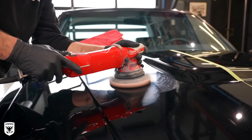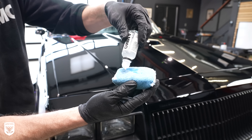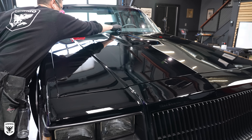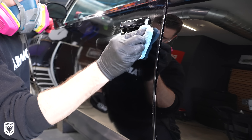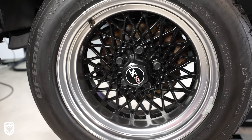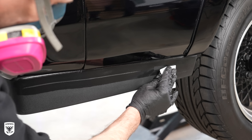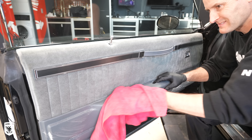Now, if we talk about the pad — I like utilizing a used pad when the paint is being really soft, sticky, or weird. I go with a used one versus one that is brand new. The analogy I like to use is it's like putting on jeans you've had for many years versus a new stiff pair from the store. This was a used pad, but I cleaned it out and dried it, going through all the proper process to make sure it's nice and clean. It's more compliant and smooth, able to get around little edges. I don't have anything scientific to tell you — it's just my gut feeling that used pads, ones already broken in, are way better on soft paint.